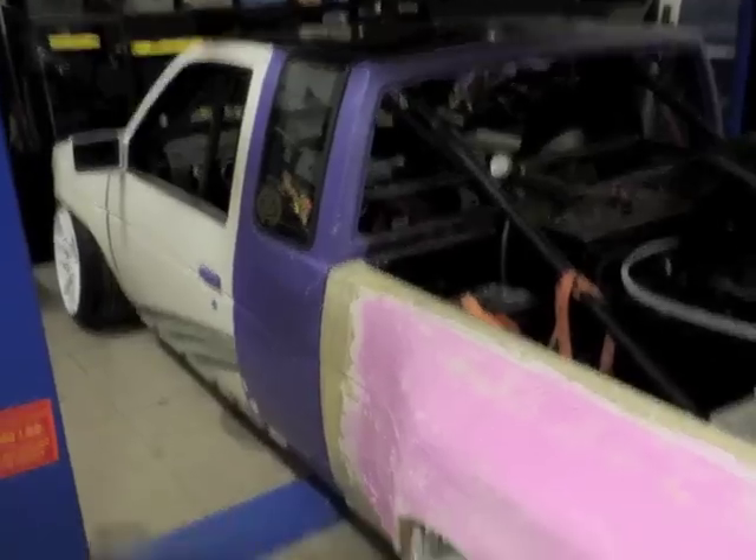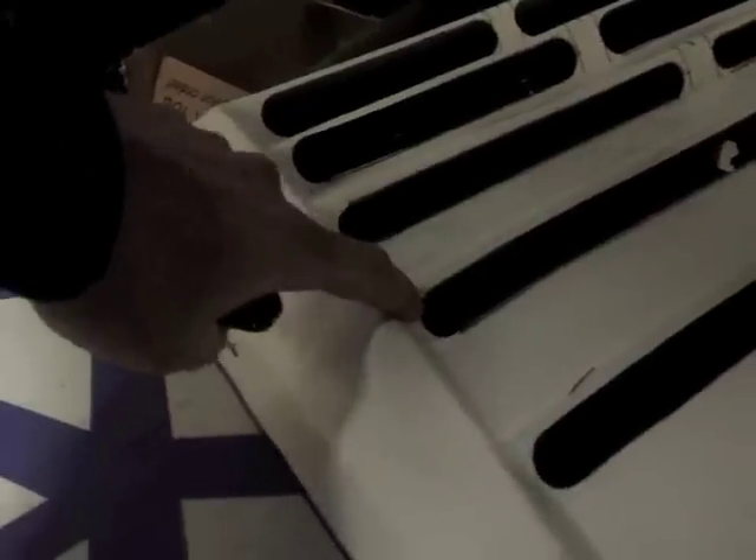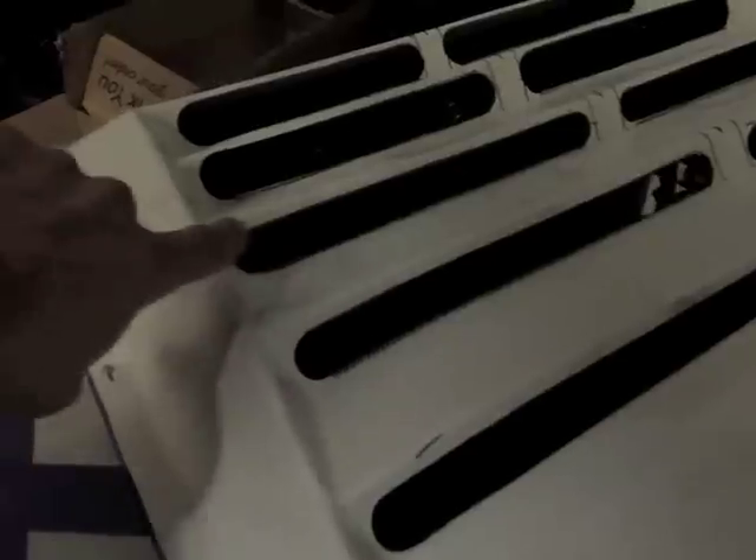Part two - I don't know when I'll have a chance to really work on this again. Also, the other day I did my aluminum roof skin that I've been meaning to do - turned out pretty good and it's much lighter than the steel one. I also put on my hood vent. A lot of people just cut these things square with a cutoff wheel and I think that looks kind of cheesy, so I used a unibit and drilled it so all the edges are radiused - I think it looks a little bit better and it's different. Also installed my rear view mirror and steering wheel hook. Interior is looking very race car now. Stay tuned for part two.